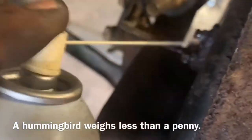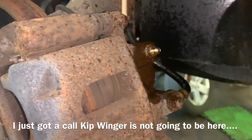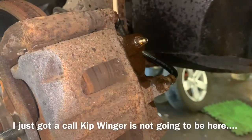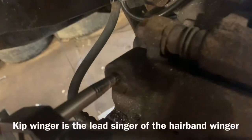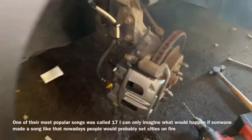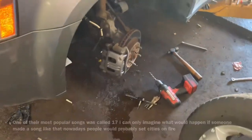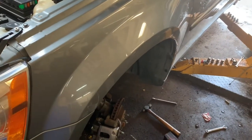If you've got rusty bleeders like me, it's not a bad idea to spray them with some PB Blaster. Just for the few of you that may not know: if your bleeder screw is not on the top of your caliper, you've got your calipers on the wrong side — I've seen that quite a few times. Unfortunately we had to replace the caliper because I could not get the bleeder out. We've got all the air out of the lines now, so we're going to start the vehicle and test out the brakes.